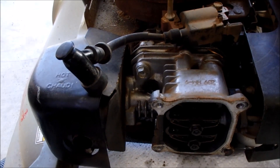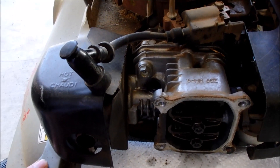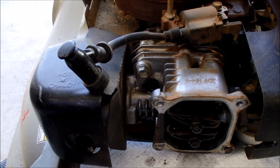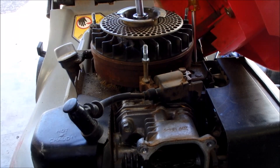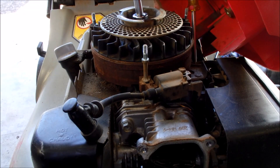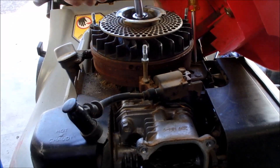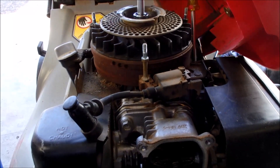I'm wondering if this thing is just low on oil. It didn't register — we may just need to put oil in here, but this engine may be damaged. This dipstick had nothing on it when I first got it. This engine was totally frozen, but I've since filled it up with oil. Let's put some 30 weight in here. It has been spinning around and it's getting easier now. I think I'll put my drill on here and just rotate it around a little more. The engine's not seized — I think they just ran it out of oil. But will it ever run again?